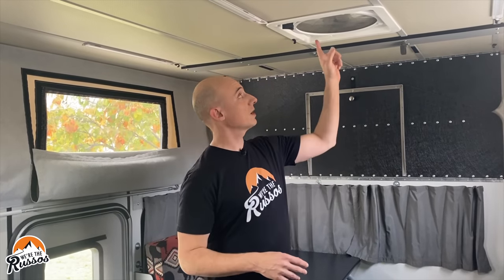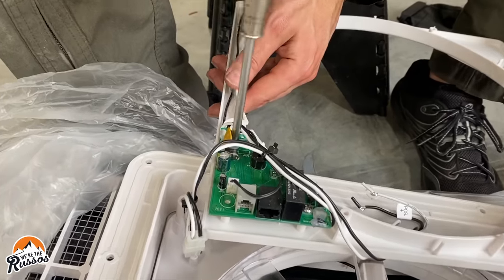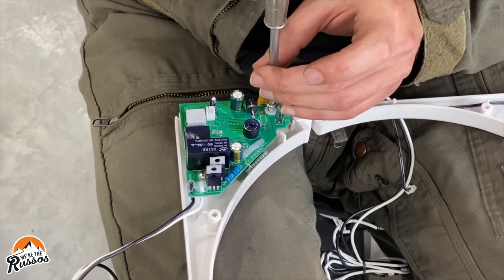We have run into an issue with the Max Air vent fans. The control board for the fans sits right above the buttons, and in some cold weather we got a lot of condensation in the camper. What happened was the condensation built up on top of that control board, and the first time I went to start the fan up there was still some moisture on there and it shorted out the board. I called customer service and they quickly sent me a new part — it was easy to swap out myself. Doing some research online, I found this is actually a common problem, and the solution is to take your board and spray it with conformal coating, which protects it from moisture. When we got our second fan, before I even installed it I took the board out, sprayed it with conformal coating, and the fan hasn't had an issue since.